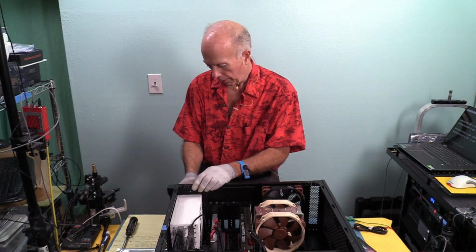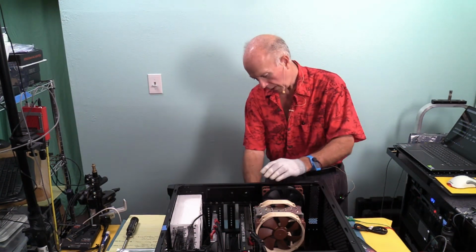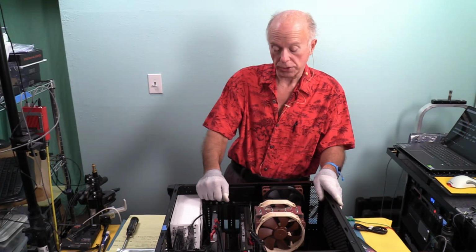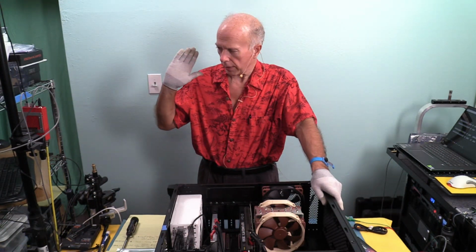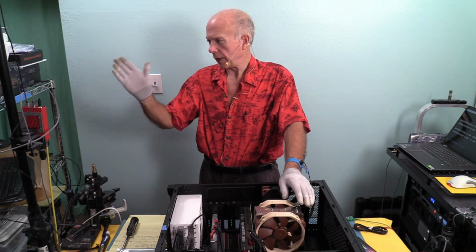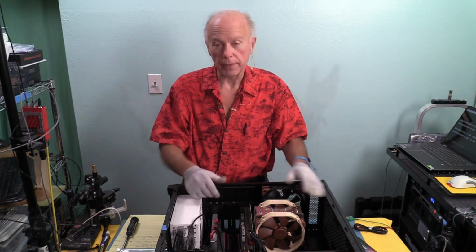So we'll plug in power first. Then we need to plug in our video for HDMI, because everything we do goes out SDI. That allows us to do our video switching. So for this, the output I'll see, I come out HDMI. I go into a Decimator HDMI converter. That then allows me to take it to the video switches, which is what you see, and a separate feed for HDMI comes out to the monitor that I can see. Pretty cool, the magic of broadcast.